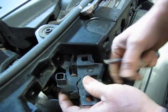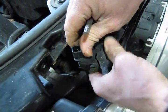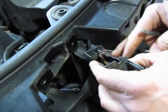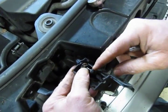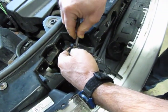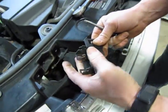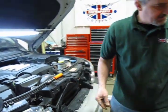If you look on the bottom you'll see the switch we're going to be replacing. We're simply going to break that off. Then push in on the release mechanism so we can pull the cable up and out. You can just pry that out of there — there's a little rubber grommet. There we go, so now we're off. We've got this disconnected and we'll set it aside.